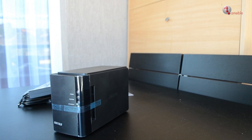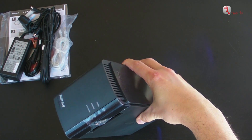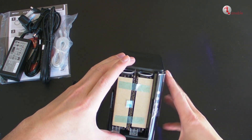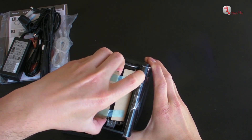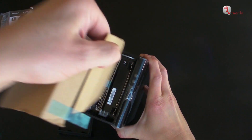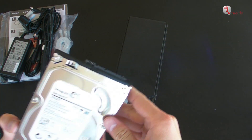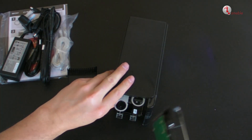We will now open the front panel and show you the removable hard drives, which are very easy to access. The Buffalo Link Station Duo is a nice device available in configurations of either one terabyte, two terabyte, or four terabyte, fitted with two 500GB drives, two 1TB drives, or two 2TB drives respectively. This one is four terabyte. These drives can be configured in either RAID 1, RAID 0, or with each drive showing separately — the RAID 1 option is obviously the safest way.